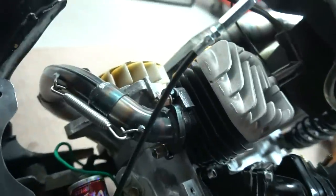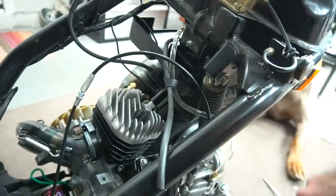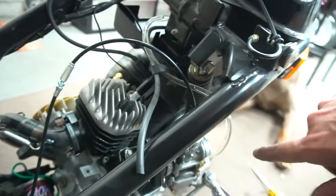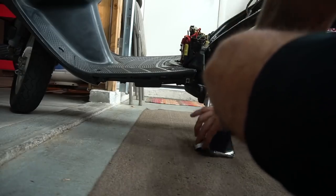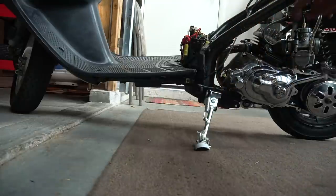So when I was sitting here trying to prime the bike and I was sucking, I was getting no fuel going through. If anything, it would come through when I blew. That was telling me that something was wrong with the circulation of fuel. Now it's sucking through, so I guarantee fuel is in this bowl now, so this bike should fire right up. See a bunch of fuel going in there now, boys. Let's see what's cracking with the 72.